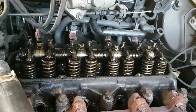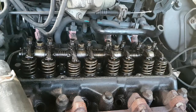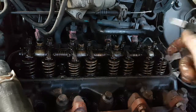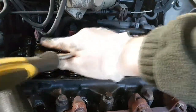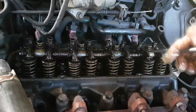Now guys, what I'm going to do is leave you here, go under the car, crank the engine a little bit, and then come back. Right guys — now this inlet is open, that exhaust is open. I'm going to just check these. That one's fine. Then we just need to do this exhaust and then that inlet — then we should be done.